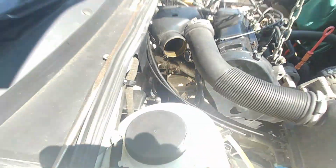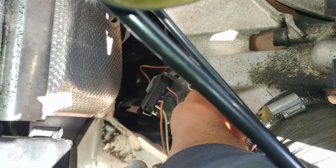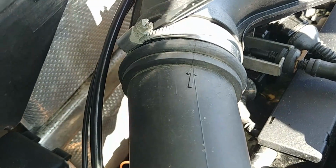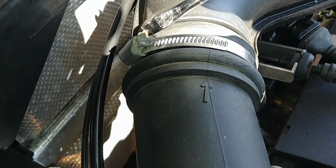Okay, then the back engine support mount we need to tighten as well. There's a bolt. I need a long extension to reach there. When it's aligned, start tightening that. That one you can tighten if you want, that won't affect anything. And over the top there's a little bracket for the electrical connector. Tighten that. Done. Put the air intake pipe back. Tighten that hose clamp. Make sure it won't leak. Simple as it is. Very easy design. It's a mono injector.